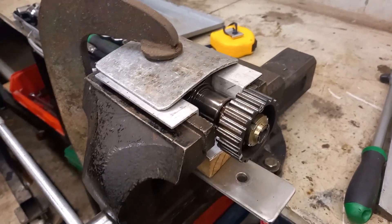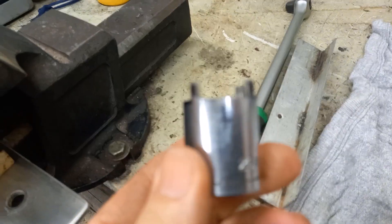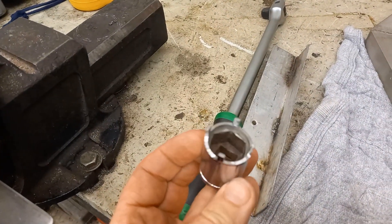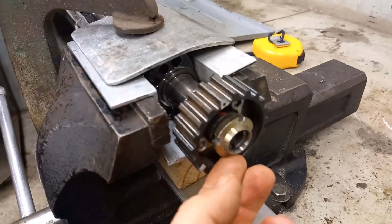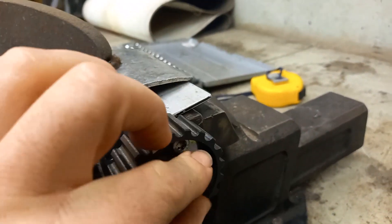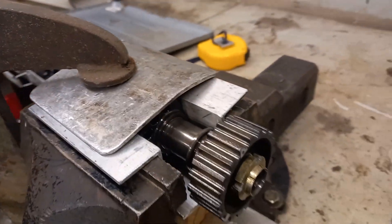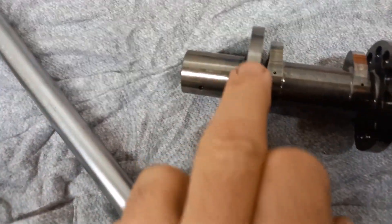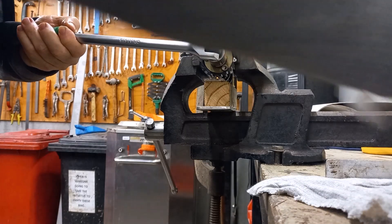We need a nice solid bench. These are 70 newton meters but it seems to be a lot tighter than that. I've got it all packed with aluminium around it so we don't scratch the cam, and I've ground down a socket to try and make it work. That nut cracked off with a bit of a bang when it broke loose. The pulley's on there tight but there's no damage or scratching to the cam because we used aluminium, which is much softer.